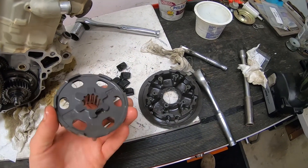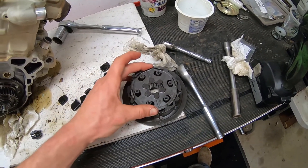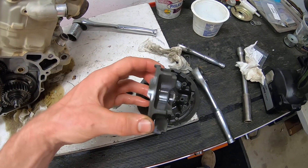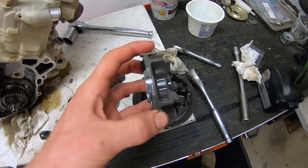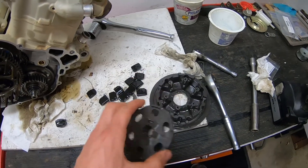Fortunately, no real damage. The clutch inner basket — this is the piece that sits in there. It's got a little bit of wear on the outside, just from all the relative motion from being run with the totally trashed rubbers, but it shouldn't affect functionality. So I'm going to keep digging and see what I find.